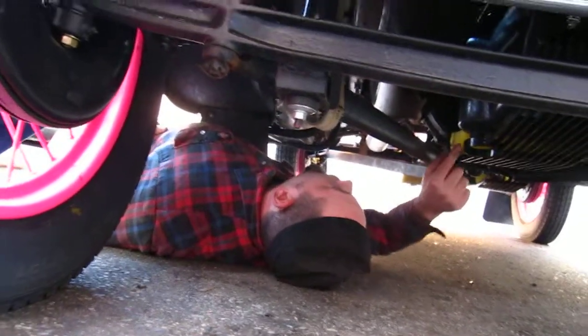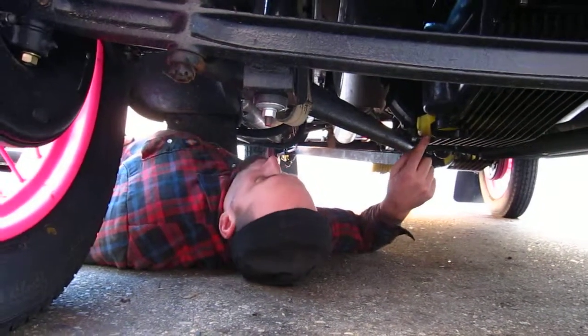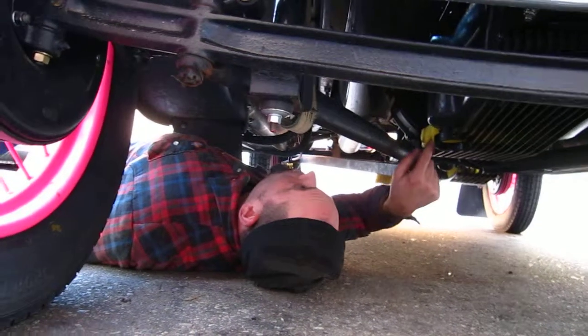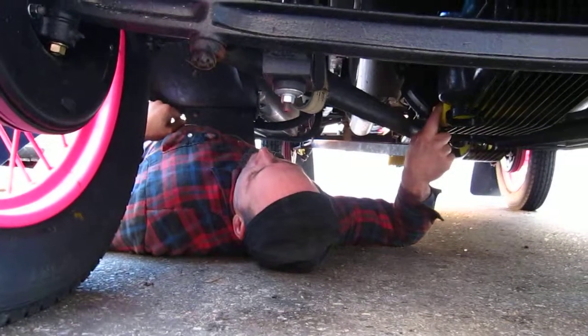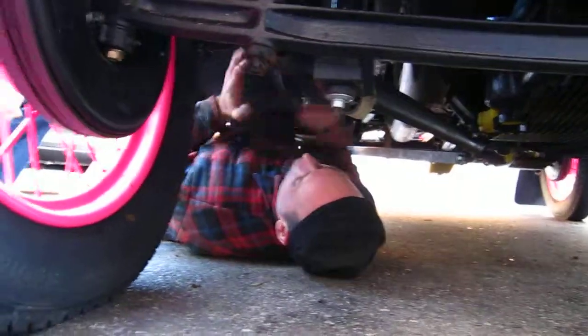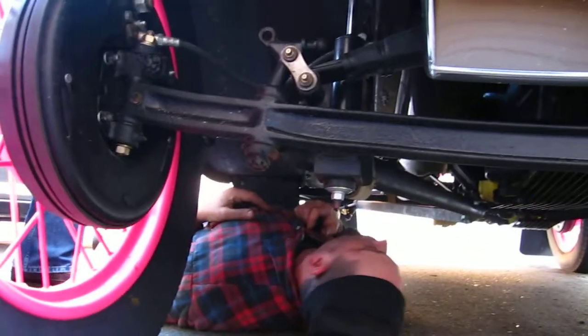I put the foam there. I was reading a little bit more about the prep guide and they say — which makes sense if you think about it — if you put a piece of foam between the engine, or whatever you're trying to protect, and the skid plate, then nothing can actually gather on top of the skid plate. So if you hit something again, it's not going to poke your oil pan or whatever. Great idea.